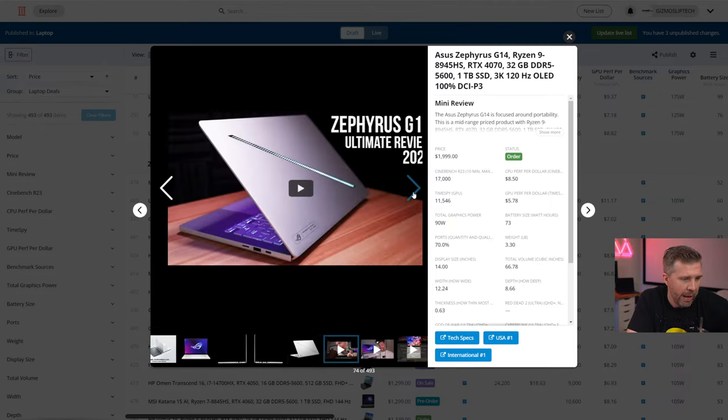Takes a little while. The G14 ramps its fans very slowly. It doesn't do it super fast. You can see it's climbing up gradually. It sounds much better, I think, to the end user to have the fans gradually change like this. The only downside is temps can spike temporarily into thermal throttle range if the fans don't activate quickly enough. So I kind of wish it had a little faster activation curve.